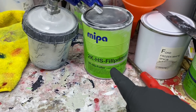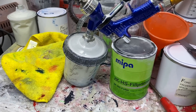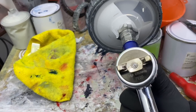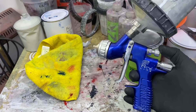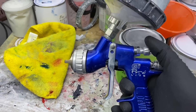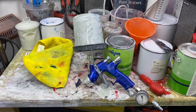There we go - I just mixed up some wet-on-wet primer. This is from Mipa, the 2K HS fill primer is what they call it. It's mixed at five parts primer to one part hardener and 20 to 25 percent thinners. I'm just going to run it through my Pro Light gun, this is a 1.3 tip. We're going to give it two coats - first coat with about five to ten minute flash-off time, then another coat, then leave it fifteen to twenty minutes and we can paint over it. Once we finish the last coat we can start getting our gun ready for base coat.